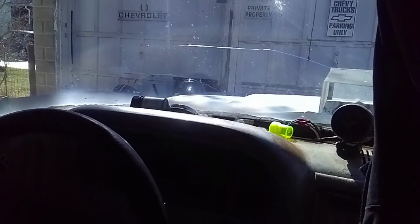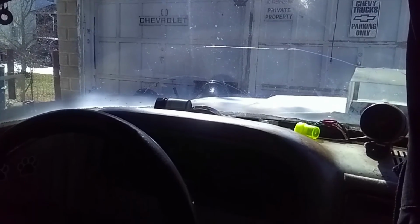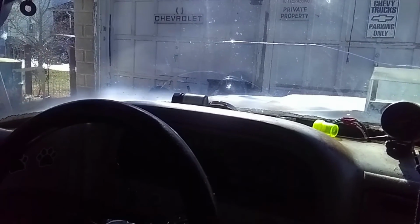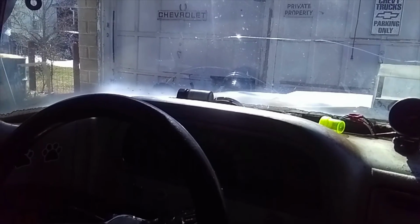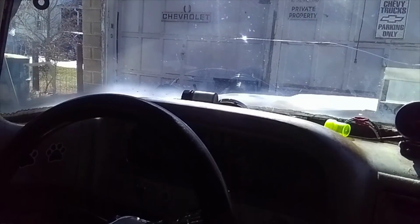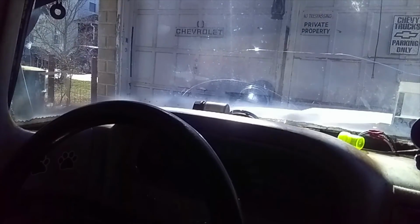In the last video I kept rattling on about a set of Buick Roadmaster exhaust manifolds. I had a pair of manifolds I removed from the same 93 Buick Roadmaster that the engine in this truck came out of. Actually, they were on this engine. I was hoping to use them because they're in great shape and I have a Y-pipe for them, so I could just stick the Y-pipe on and weld one stick to it and be done with it. But unfortunately, the 93 engine those manifolds came off of had a passenger side dipstick, and the 76 engine that we're putting in the truck has a driver's side dipstick, and the downpipe on the driver's side and the dipstick are trying to occupy the same space, so that's a no bueno. So I think we're going to be using these Suburban manifolds to put that together.